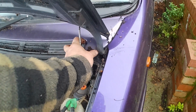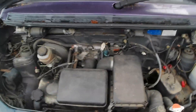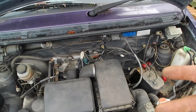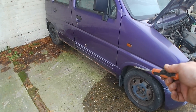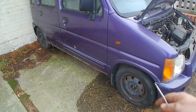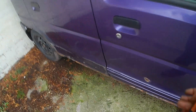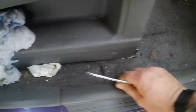Get some of this crap out of the vents. Not bad, could be a lot worse, but I know it's going to need the inner sill, strengthening sill, and the outer sill - I've got the outer sill at home. I've also got the steel in order to repair it. It does mean though, because it's got the hole, I'm going to have to take the seat out and the carpet. If we take that panel out - it just pops off - you can see daylight through these holes. I'm pretty sure you're not meant to be able to do that.